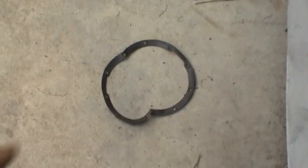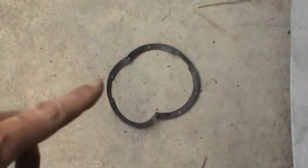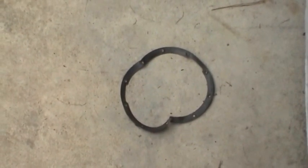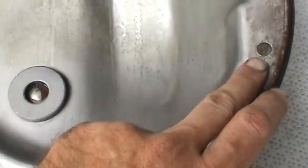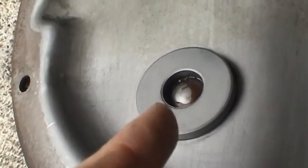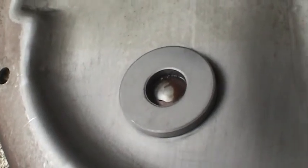Okay, the old gasket down there came off largely in one piece, and it's kind of interesting GM used a gasket because most of the differentials I've seen have just used some form of heavy-duty RTV. And I got the differential cover all cleaned up just using a razor blade, scraped all the gasket material off of there. Got that magnet as clean as I could, just used some compressed air to blow off a lot of the debris that was on there after wiping it down real good.